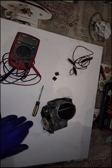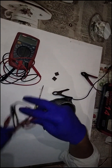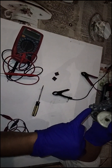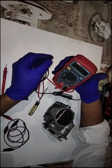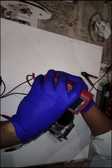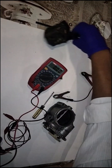So here we have the power supply. We're first going to check that we do have power. We're going to use the gator clips to transfer the power to the points on the voltmeter and then to the throttle body, because we need to get power inside here to power the motor. We are working with DC — direct current — 12 volts, so we're going to set the voltmeter to 20 volts, and this will tell us the voltage and allow us to take measurements. Let me just move all the stuff aside so there's no disturbance.